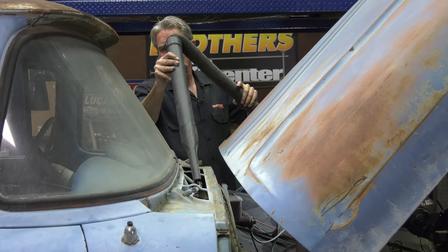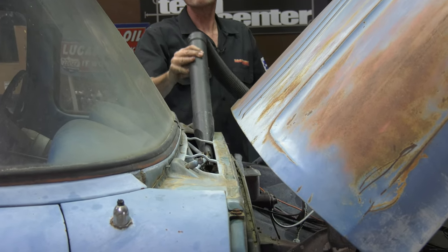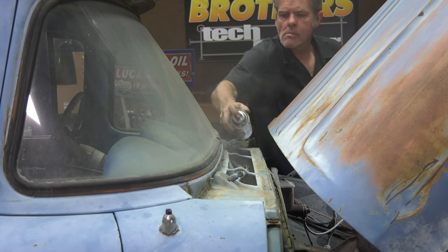This is going to be a lot less expensive than paying me to do it for you. Now before I put my piece on, I want to make sure that this is all prepared properly too. Remember, it's all the dirt that falls in here and the water that comes down and collects and causes all the rust problems in the front of your cabs and fenders. So get all that dirt out of there. If you've got any rust in there, go ahead and shoot some rust converter on there or paint it all up, but get that all prepped before you put this on.